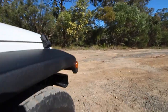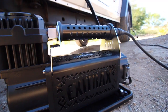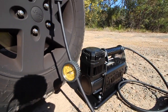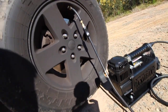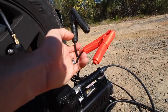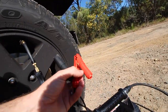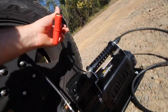Let's have a look at the air compressor. We've dropped the tyres in the Jeep down to 25 PSI for a bit of a 4WD today. It comes with a bar gauge, and an air bleed-off button on the back of the gauge, so you can just hook that up and bleed it down to the right PSI. It also has battery clamps — I'm not sure if I want to keep these on the compressor all the time. I do have an Anderson plug in the back of the Jeep that I might hook these up to instead.